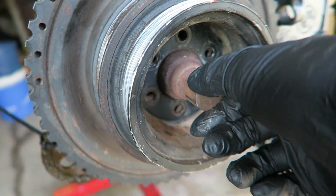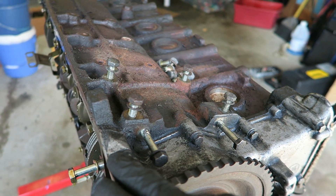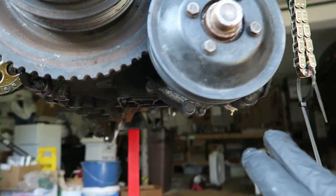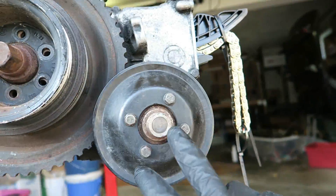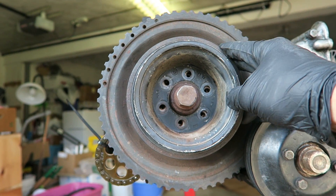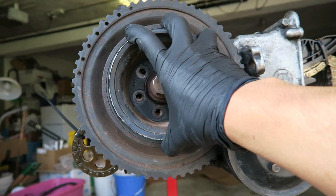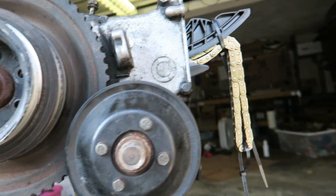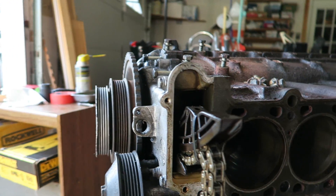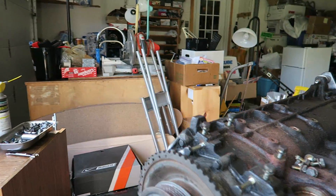I already cracked this loose, and I'll explain how I loosened that. To take apart the timing case cover, it's going to be the 10mm bolts on the side over here, all the way around. I have to remove the water pump first in order to get access to this harmonic balancer unit that originally also contains the AC belt, and then basically this whole unit should just pop right off. That will get me access to the inside where you will see all the timing chain guide rails and everything like that.